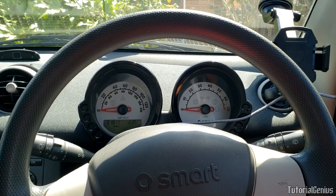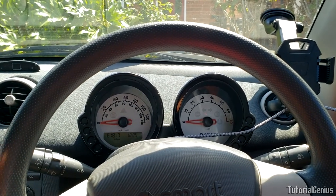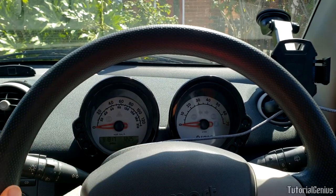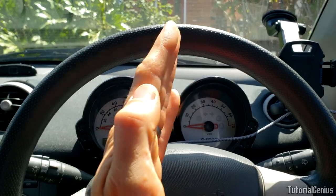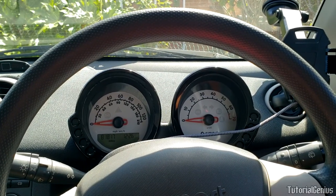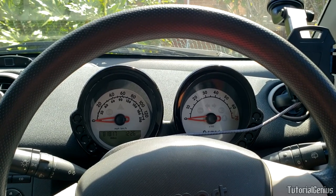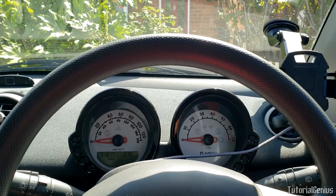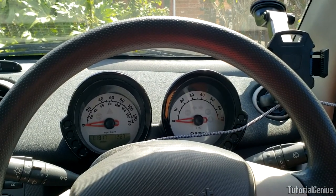The last symptom is generic handling. When driving, perhaps on the freeway, your car might feel a little erratic — you're holding the steering wheel steady but the car seems to have a mind of its own. A strong gust of wind might cause increased body roll and you might find yourself veering, feeling a bit top heavy. Going over bumps or road inconsistencies, the car may wander or swerve unexpectedly. You may also have poor traction and longer stopping distances when you apply the brakes.